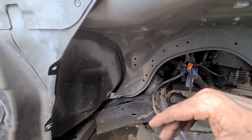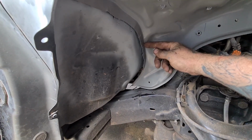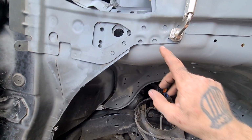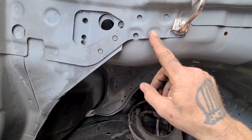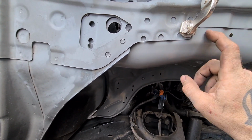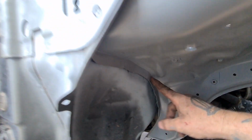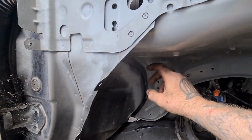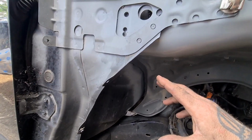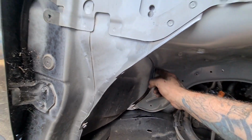So what you want to do on those, you get yourself about a 4mm drill bit or so and drill where you want them. Imagine that they're your 4mm holes, these are obviously pretty big, that's where we had to cut the spot welds. You only drill through this panel, not through this. You want the backing plate there. That's why you take it back off, because I'll mark up where I want to put them and drill all the ones that need to be spotted, then stick it back on and spot weld.